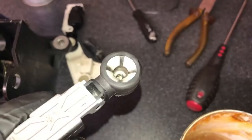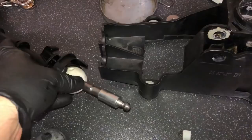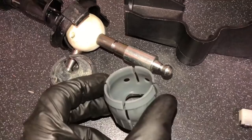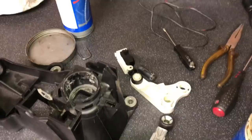I'm going to clean all that out — it'll make for nice smooth shifting. You can see how nasty it is and you can see the old grease on there, just get rid of that and it'll be as good as new when done. You can see the short shifter on there — that's the one I'm replacing for a longer version. You can see the wear inside the ball joint where the cup goes, and you can see how much thicker the wall is on the new one, which is going to remove all the play. I'm taking the roller bits apart and greasing everything up so when it goes back together it gives a nice seamless shift.